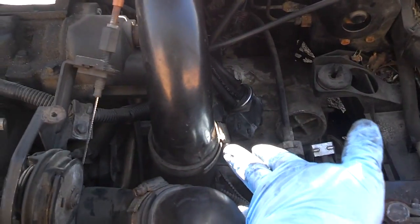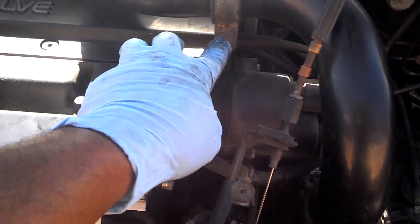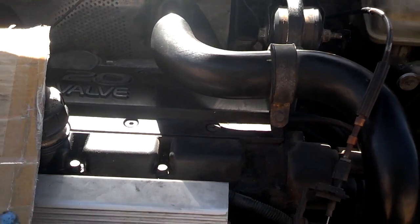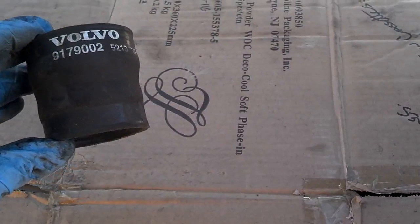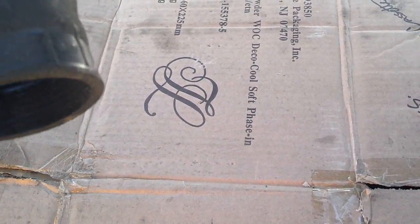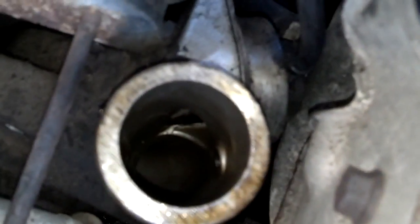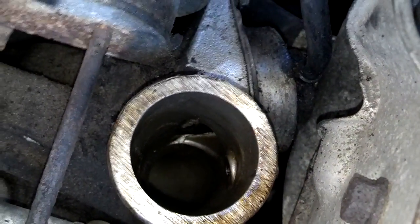I see a major struggle getting this valve loose with this tube here, so I'm going to go ahead and take this tube out. There's a 7mm there, 10mm there, and a 7mm on the back side of it — the short hose. I actually grabbed that short hose while I was at the salvage yard just in case mine was bad; this one looks in pretty good shape. With this turbo bypass tube off, I have a lot clearer shot at getting those bolts off of that valve there.